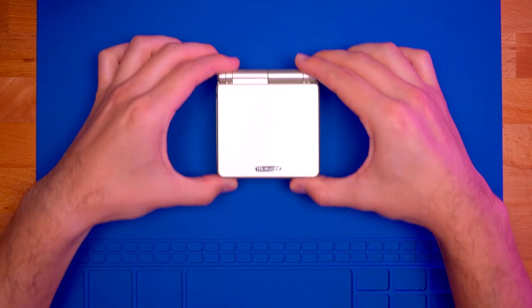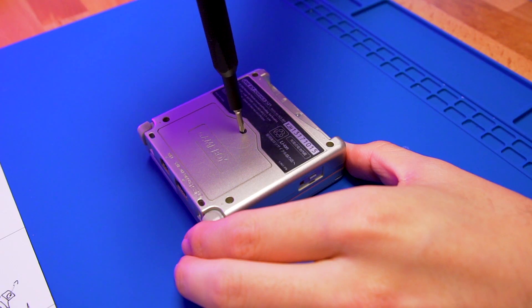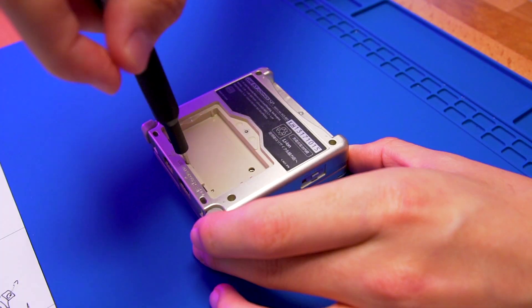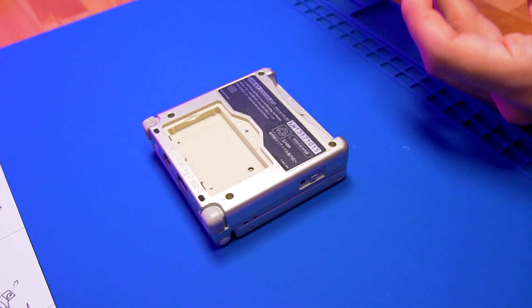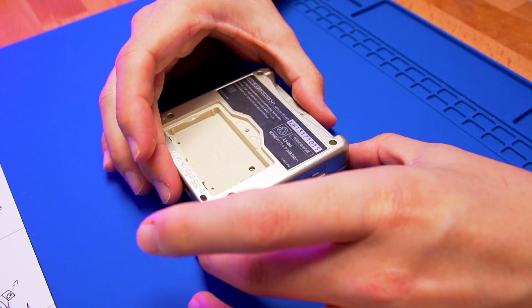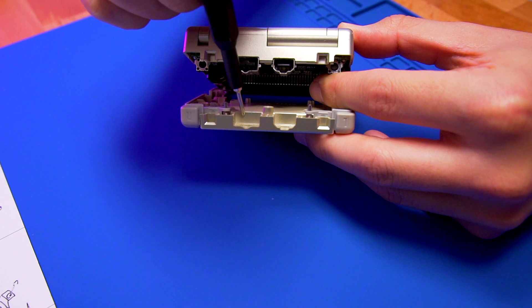That's really everything you're going to need. If you want to try this mod yourself, I'll have a link to this wireless charging receiver in the description below. Let's dive right into the installation. To start, remove the battery by unfastening the Phillips screw for the battery door. Then remove the remaining six tri-point screws and then the rear shell housing itself. As far as disassembly of the console, that's all we need to do. Next, we need to make a small hole in the shell in the portion that is right behind the charging port.